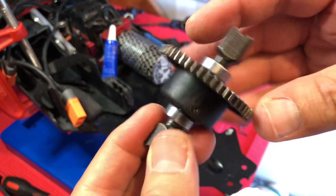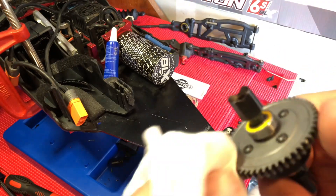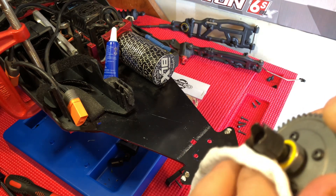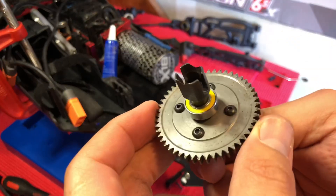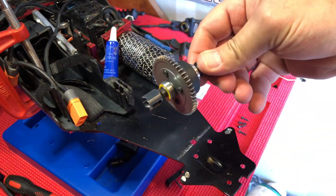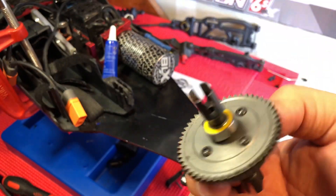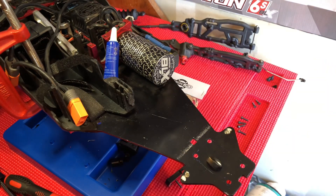I'm really hoping that after having these Tech Joe gaskets my concerns are going to be lessened in the future, because the last thing you want is a slow leak in your diff. Over the course of a few days or weeks you could pretty much lose all the oil in your diff housing and you're running bare dry in there, just looking for trouble.